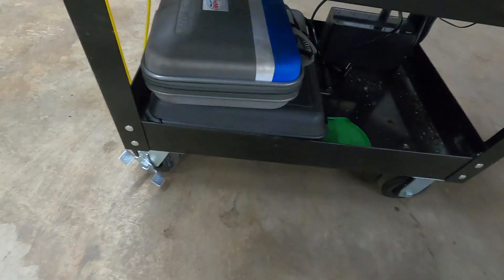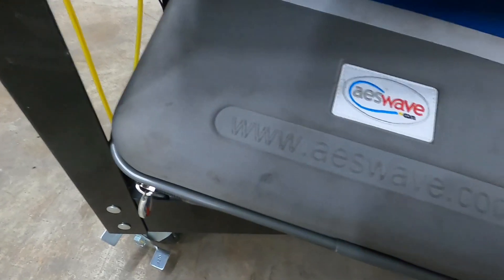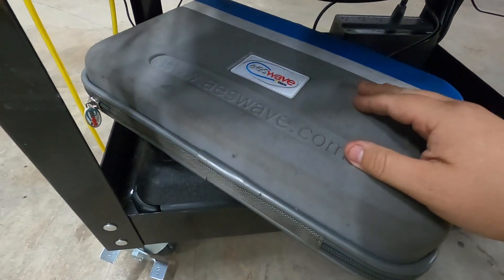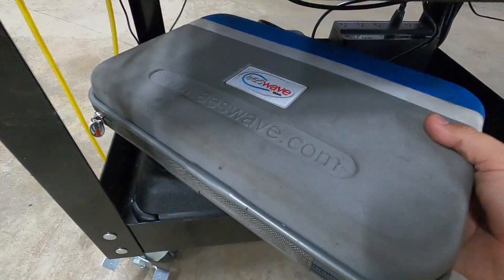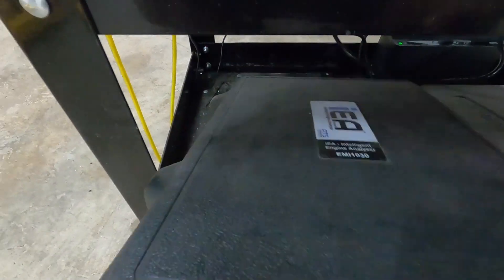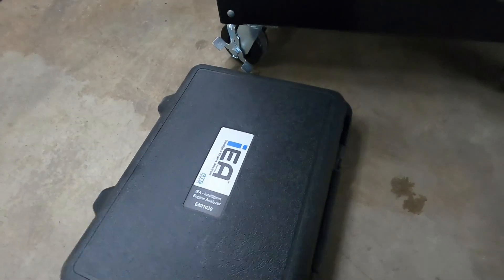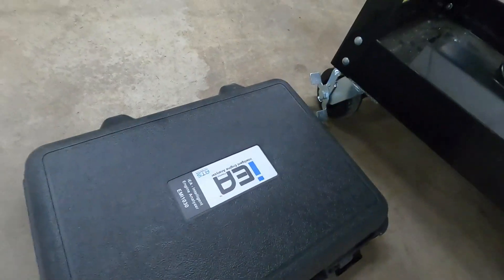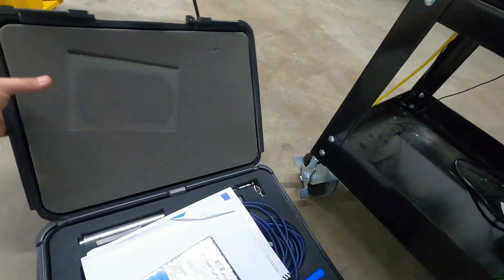I've got a breakout box, a charger for the ATS scope, and one of our very old 12-volt boxes — if I needed to supply 12 volts, it'll give you a voltage reading and amperage. I've used that for testing circuits just to see if a circuit is being overloaded because it will tell me the amperage while it's in line. Down below we've got the AES wave U-test kit — I use this tons. It's really good for making your own breakout leads or just test leads in general.